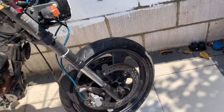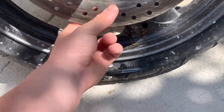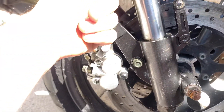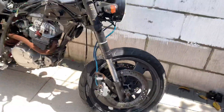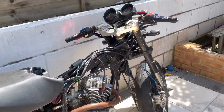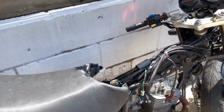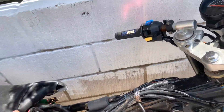The front tyre isn't getting changed for a while. There's some liquid near the brake disc and it's oily — looks like the forks. So we need fork seals. They're probably the same as a Pulse Adrenaline, so it shouldn't be too hard; if not I'll just find the ones that fit. This bike just really isn't doing much at the moment. I bought it for Lauren, not myself, but it just needs money put into it — money that I currently don't have, and Lauren doesn't either.